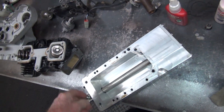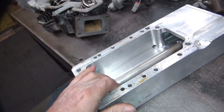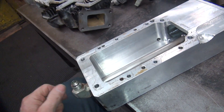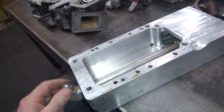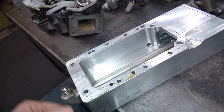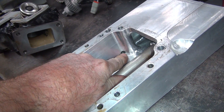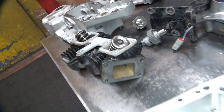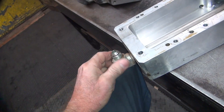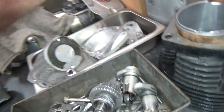You never know how things work until you have problems. The electric fuel pump sucks this dry, and once it sucks all the oil out it starts sucking air — it's a rotary vane pump, same as a vacuum pump on a race car, like a smog pump. The Holley fuel pump is the same thing, just smaller. We also have the stock pump sucking oil out here, so it's got double suction, plus the big one just sucking everything out. So you don't have a lot of oil building up, the flywheels are free to spin with no oil — which is good.